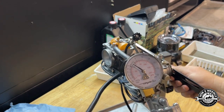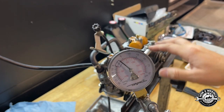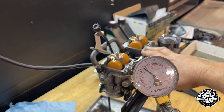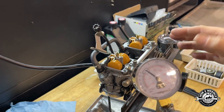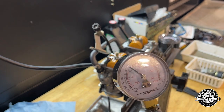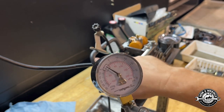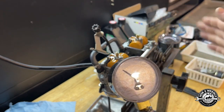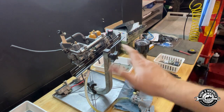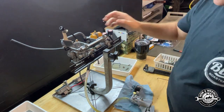We can get a really good solid test now. I don't need the floats in to do this — I could use my thumb, or a plug, to determine what I have going on. I also just did both of them at the same time from a single fuel source. If I was really concerned there was a problem with just one, I'd take the hoses off and pinpoint one carburetor. So I'm going to do a performance test to see what PSI each one can hold on its own.